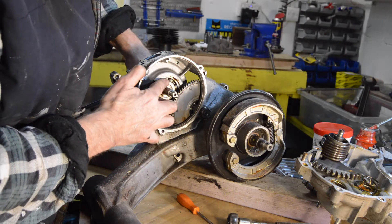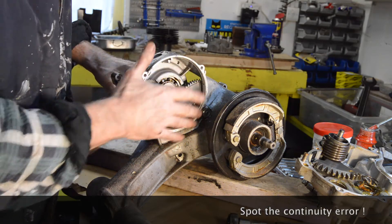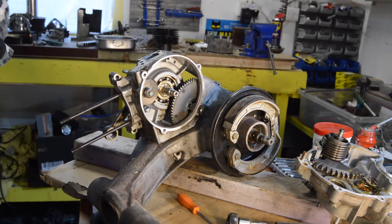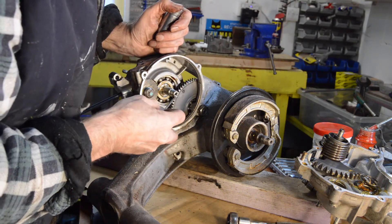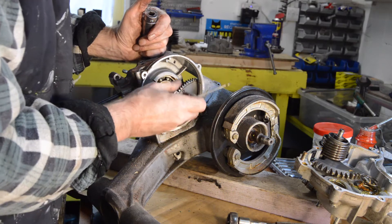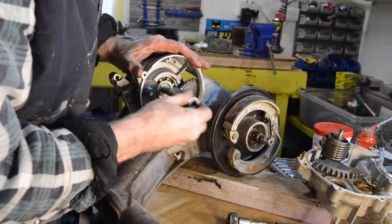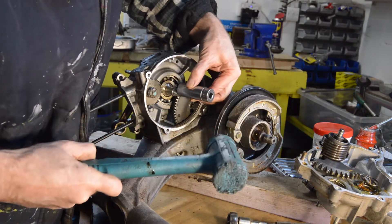There's the crank sitting in the bearing. I believe there is a tool to press them out, which I haven't got. So a very gentle tap — it's a little bit tight. I don't want to touch it on the end of the threads very hard, obviously. I haven't got a nut to go on there, that's missing. The inside of the crank is there, and that deep socket will neatly fit over the crank onto there and bear directly on it.